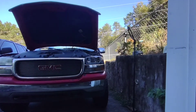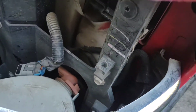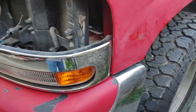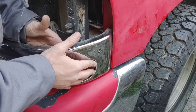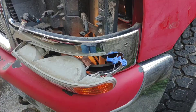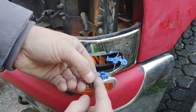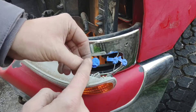I'm going to pop the light back out and tie in the wires to the marker light so we can see what that's going to look like. We'll pop the lower out to make it easier to get the wires in. All you do is squeeze that tang and pull out with the other hand — that's how easy it is to get out. Now for wiring: I've got the scotch lock set up on the wires. All this is is a blade with two slots — the original wire goes through the first section, your new wire goes in the other slot.